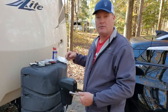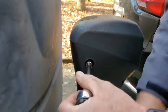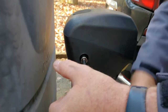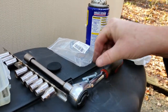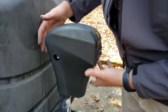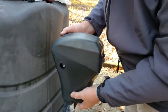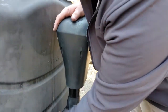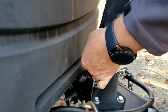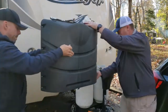Before we rotate it, we're actually going to take it off so we can get access to the holes that we need to tap. Now that we have the two bolts out, we can freely rotate the jack, but we can also lift it and take it off. One thing to be aware of is the wire here may be so tight that you might have to remove your cover or unplug it in order to get enough slack to pull it off the top.